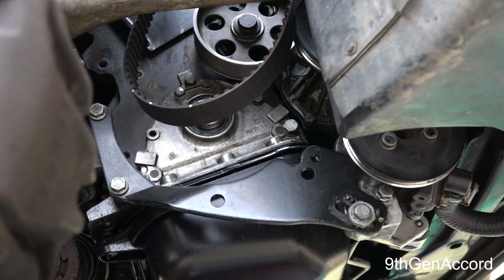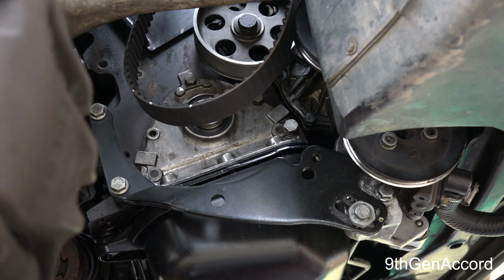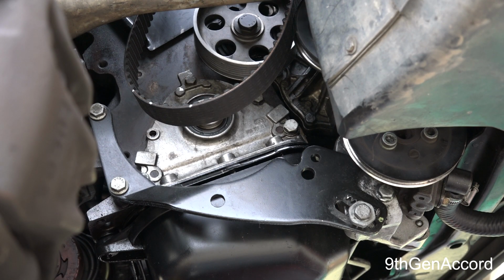All right, so the bolt that I'm going to use is a factory Volkswagen bolt. They want you to oil the threads slightly and also the shoulder of the bolt, so I'm going to do that now. This is a stretch bolt, also called torque to yield, and it doesn't use any Loctite. It basically just uses a prescribed amount of torque, which in this case is 66 foot-pounds. In addition to that, once you hit that number, you will turn the bolt another quarter turn, or 90 degrees.